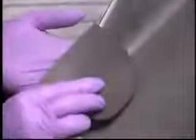When damage extends off the edge of the plastic, it is important to prepare as follows: grind or cut a V-notch on the edge to prevent the damage from propagating later. Follow the procedures to dish out the area on the front side of the repair. Apply part number 06396 Adhesion Promoter to properly cleaned plastic. Apply the Easy Fix Flexible Patch — it is recommended to extend the patch off the edge of the plastic and trim off later. After sanding, trim off the edge and complete the repair procedures.